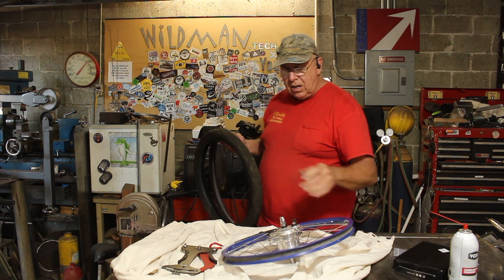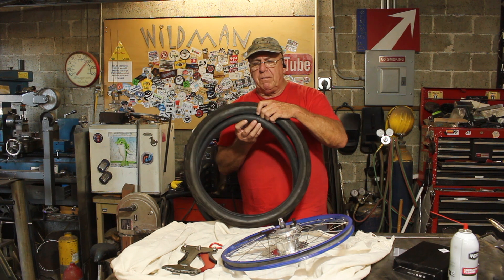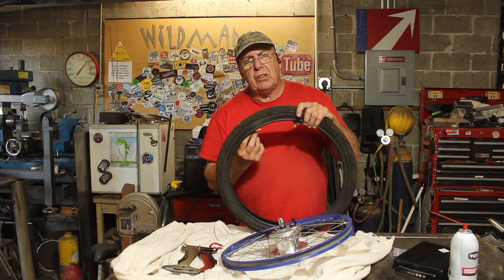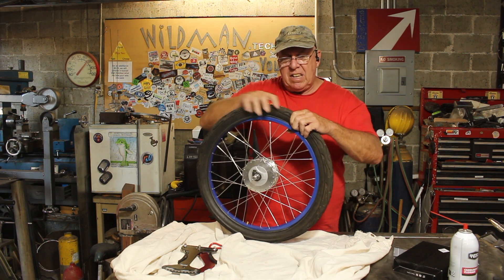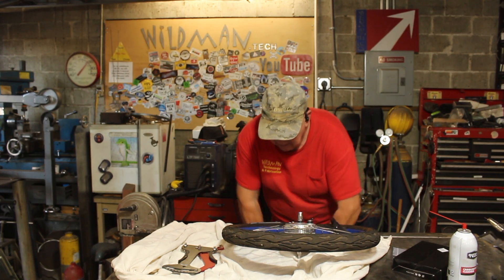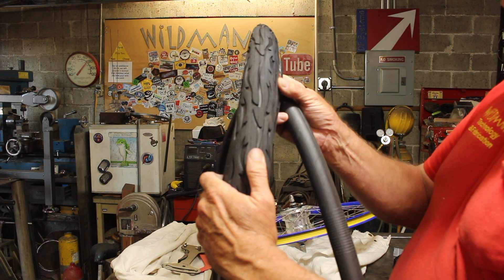The wheel is all built and now we want to install a tire on it — it has this flame tread pattern. When you're installing a tube into a tire, you want the valve stem by some mark like the tire brand. The reason for that is if you get a flat, you'll know where to look in the tire for what punctured it. I want to make sure the flame tread has the tails of the flames going toward the back. Don't waste your time on slime tubes or tire liners — if you can't find a Kevlar belted tire, just go with thorn-proof tubes; the rubber is a quarter of an inch thick.